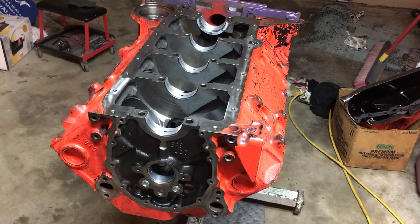The rest of the pistons have a 200 thousandths receiver groove for a regular standard oil ring setup, but these have that 165 thousandths shallow receiver groove or area for the oil rings, which makes the piston rings cost more, which is a huge headache.